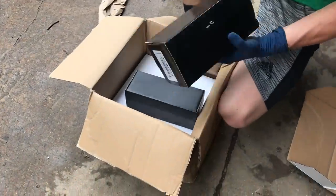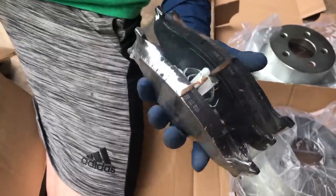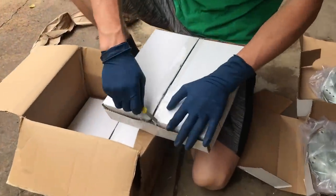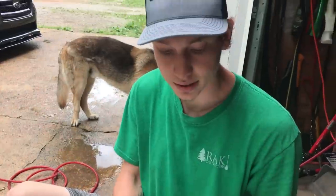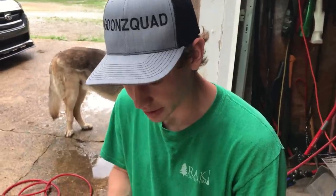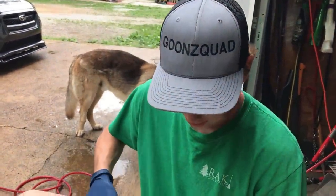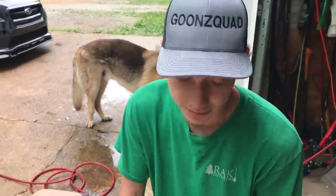Here go the brake pads — see what they're all about. Ceramic. Nice, new ceramic brake pads. These should be the rear ones. And these should be the front rotors. They look good. They're gonna keep the brakes from heating up, because they do heat up really quick with these big tires. To slow it down they're gonna cool it down a lot better and keep that Jeep braking really good throughout the whole day when you're driving. You lose that stopping power when they heat up with big 35s.